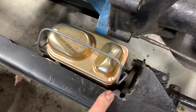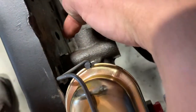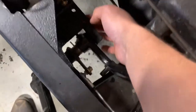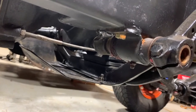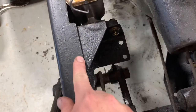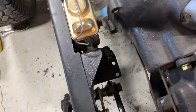For this particular master cylinder, I had to take just this little sliver out, and then down in here I had to make a little notch. But a different master cylinder might fit better and you might not have to do that. This little piece I just made is going to go in right like that and hold our pedal assembly up. As far as the pedal assembly — like I said it's welded — so I ended up just taking the air chisel to those rivets and left the original one on there and bolted it up. Everything fit great. What's left is the two mounting bolts that go right here — I've got to figure out where those are and punch those in.